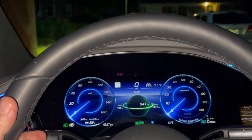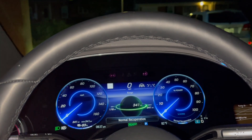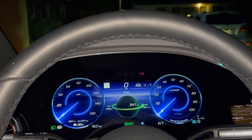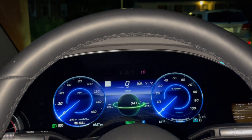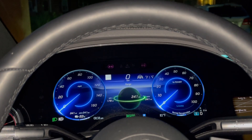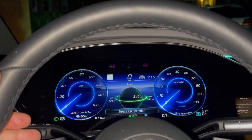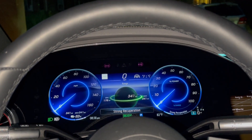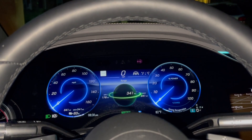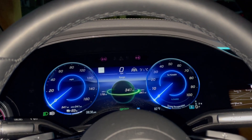If I hit the tab on the left, it goes back to normal — it skipped right over no recuperation. Normal recuperation provides slow, gradual stopping, but it takes quite a long time to actually stop the vehicle. When it's slowing down, the brake light does not come on. If I hit this one more time, it goes to strong recuperation. Strong recuperation is like you are gently hitting the brakes. The brake lights in the back do come on, and the car slows very well, and I'll show you that here in a minute in the demo.